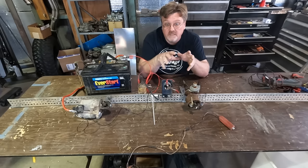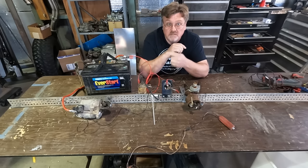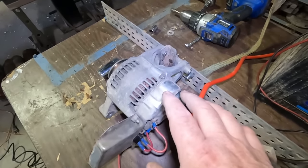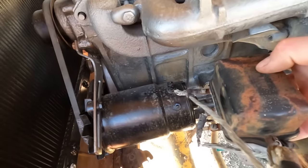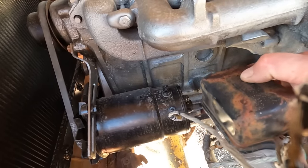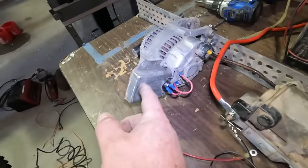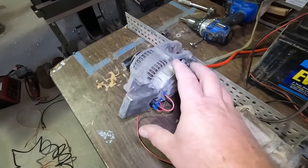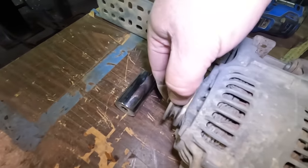At this point you're in pretty good shape for regular driving, but your battery is going to run dead because you have nothing to charge it. So we need to deal with that next. Here I have a Mopar alternator hooked up — this is one of the more complicated systems you can use because it has an external regulator. This truck uses a generator with an external regulator that's very similar to this externally regulated alternator, with the regulator piggybacked on the alternator for demonstration.